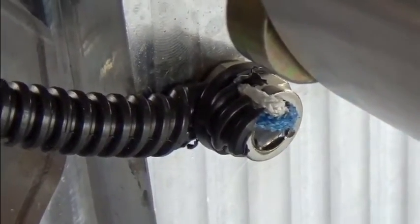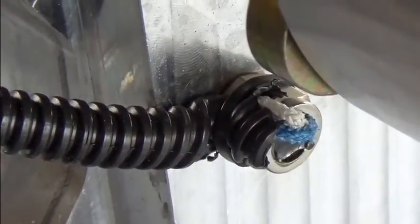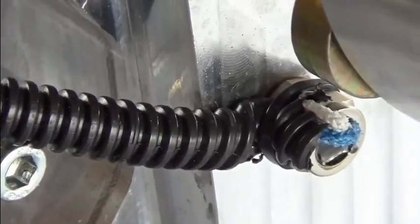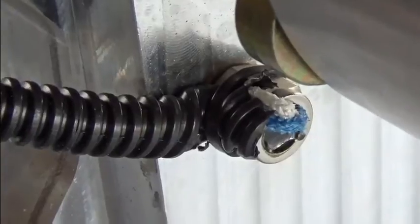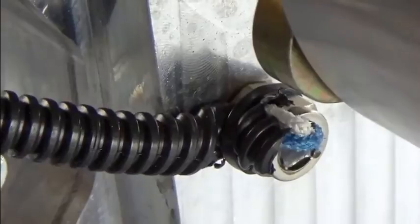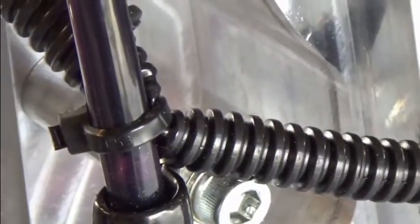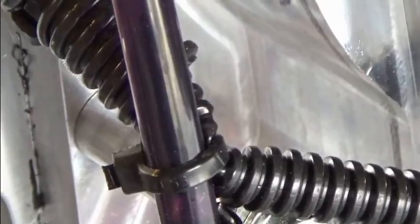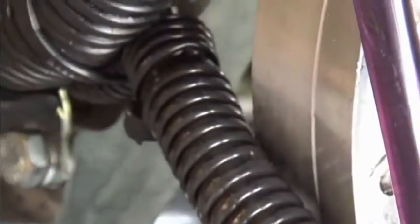Here is the first sensor, mounted inside the gearbox, which measures the oil temperature of the gearbox and ostensibly the oil temperature throughout the entire engine. There is a small black wire tie that secures the sensor leads to itself, and then the actual leads and the connector to the wire go through the engine along to the firewall and into the cabin area. It's all tied down and secured.